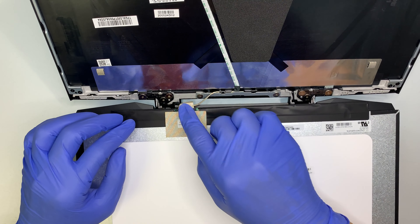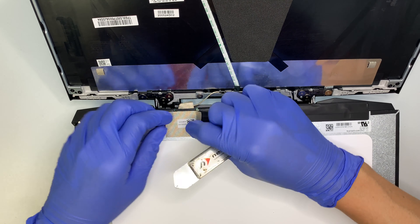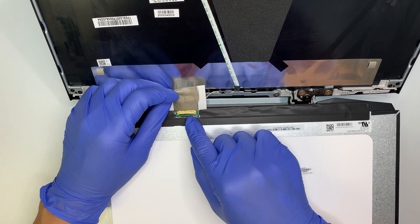At this point you want to disconnect this cable — this is a 30-pin connector. It has a little clipper that clips onto the connector, so I need to flip the clipper up. Flip it up and then slide the cable away from you — I'm sliding away from my body, going in that direction. And that's how I remove the cable. At this point your LCD would just come right out without any problem, and you can get a new screen and do a replacement.